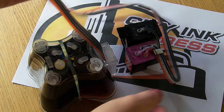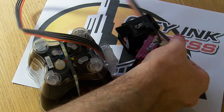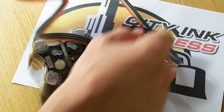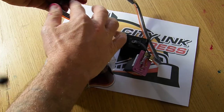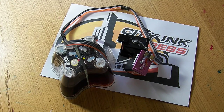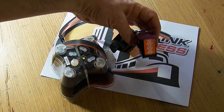We've basically removed this from the printer. We've got an issue where there's a long stretch of air in there — you can see it coming all the way down the ink line, all the way to the cartridge. Because we've taken it out of the printer, it's got no black cap on the cartridge.